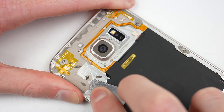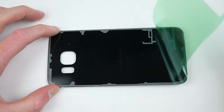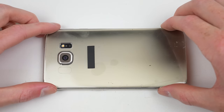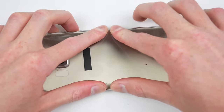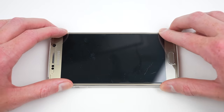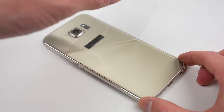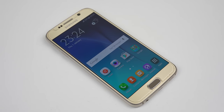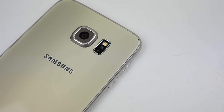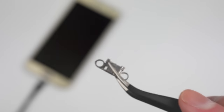Once those are installed, I'm going to try and remove as much of the superglue mess that's left behind. Once that's done, it's time to apply the new back panel. After removing the plastic protective film, it can be positioned into place and firmly pressed down. With that, we can now install a tempered glass screen protector onto the front display, and lastly remove the plastic film from our new back panel. And we're done — a repaired Galaxy S6. Definitely a repair not for the faint-hearted, but having managed to replace the port without damaging the display or anything else means this phone can live on.